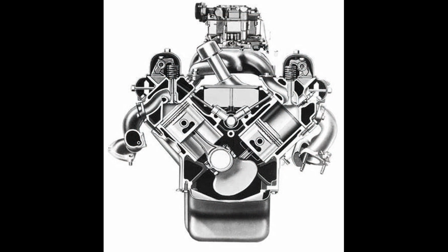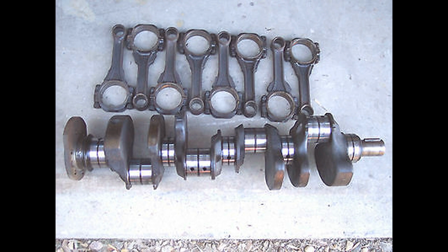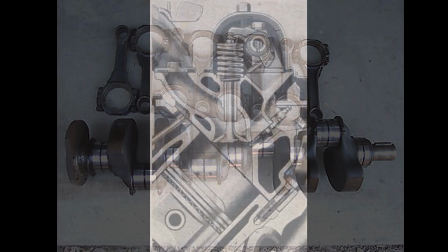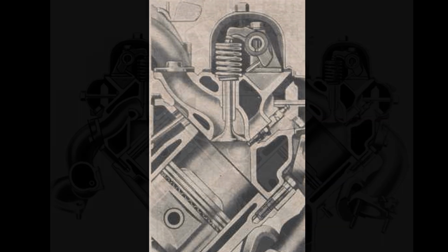The layout thoroughly embraced GM's latest short-stroke theories. All versions through 1966 employed forged, fully counterweighted cranks, and forged connecting rods. The Nailhead's identifying characteristics are its distinctive vertical valves, their stems at right angles to the pavement, and its underhand-style rocker arms, in which the top of the rocker operates the valve, the opposite of common practice. The lineage of this unusual valve train setup is easy to trace.